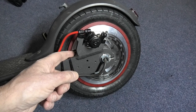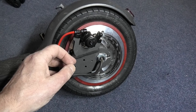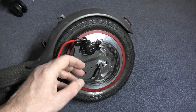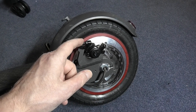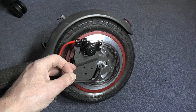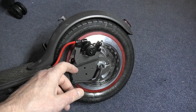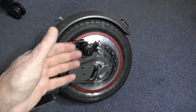What I had to do was take the one off the front and put it on the back because the valve was shorter and it was catching. I found out from the bloke who actually makes them that there is actually a nut you're supposed to put on there. I've got the inner tube off the front on the back and the back on the front. I've got two new inner tubes — I seem to remember pinching the one on the front and having to repair it, and I don't like that, so I bought two brand new ones.